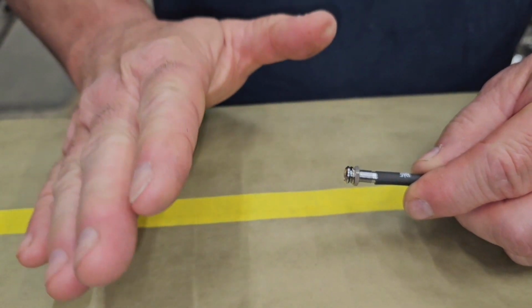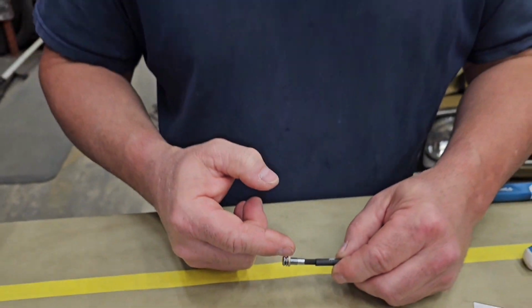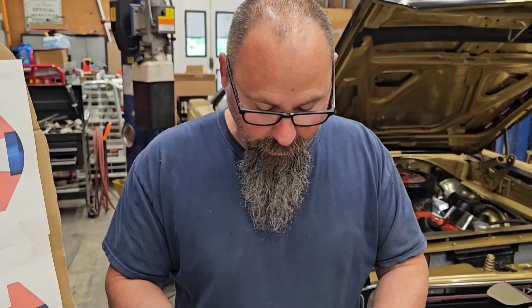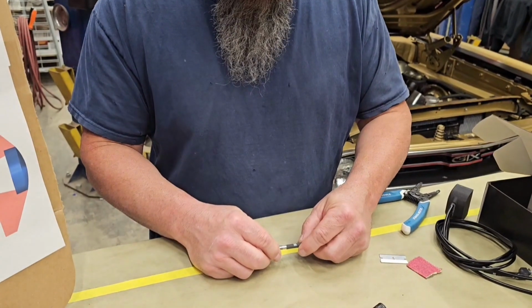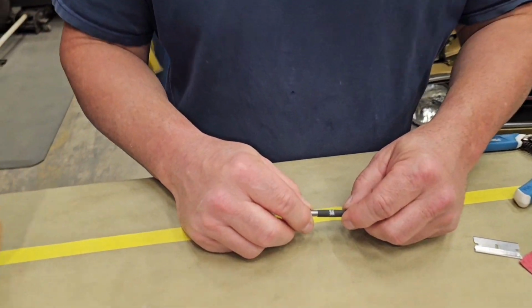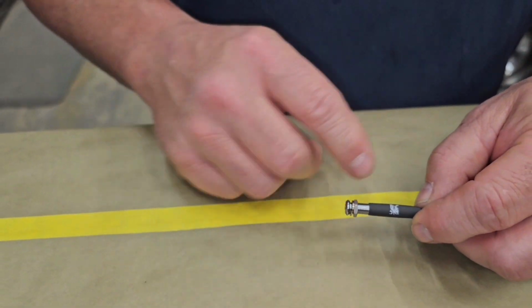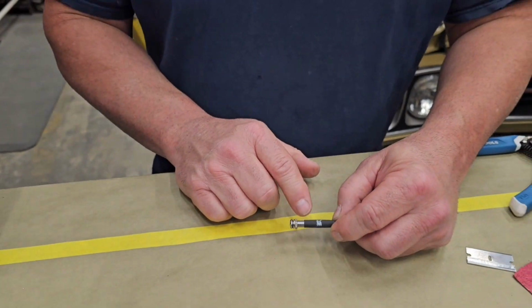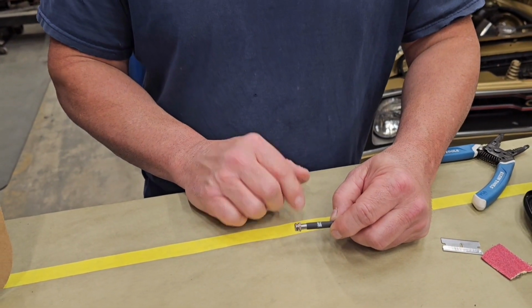Now this is after this housing is installed. Okay, now we're talking final assembly. The panel mount is already installed in whatever you're installing it in. You're going to push in the fiber, bring the adhesive back heat shrink right to the threads, and heat it up. And the glue inside the adhesive back is going to hold everything together super solid.